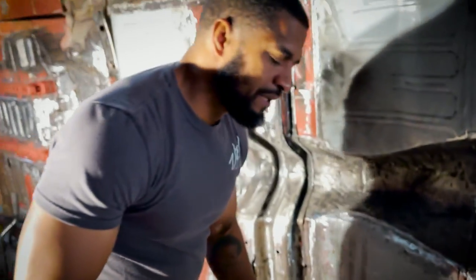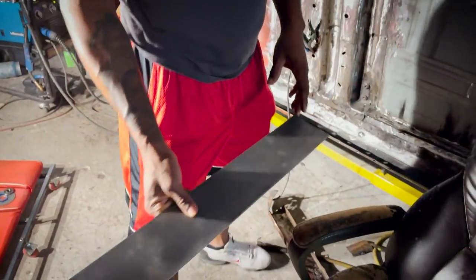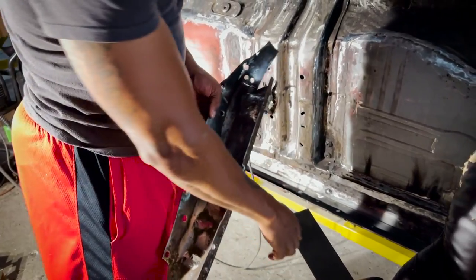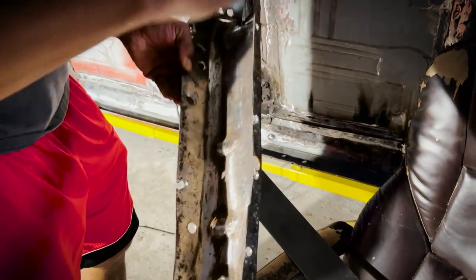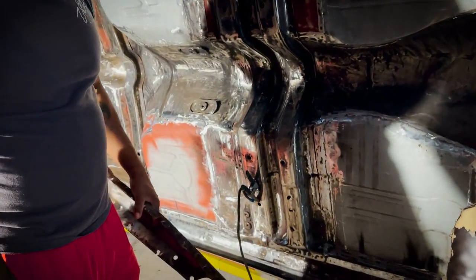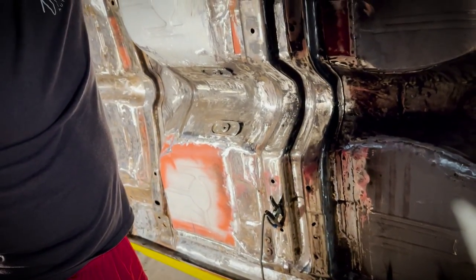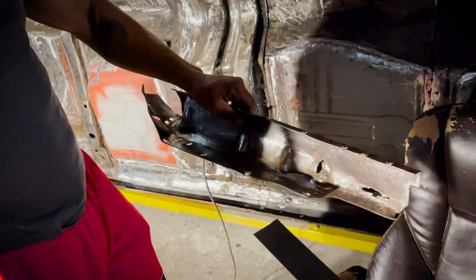But it's so thick, with a big metal brake we could bend an inch. But now he'll just cut an inch, because this is a 4-inch piece and the interior piece of this is like 3 inches. So he could take an inch off of this, and then all of the bends, you could basically weld them at that angle. Once you tack it in, take the whole piece out, weld it solid, and then you've got a replica of this at that thickness. And then we've got to double it up. The first one is always the longest one, figuring it out, because it's coming out of your brain. It's kind of like freestyling.